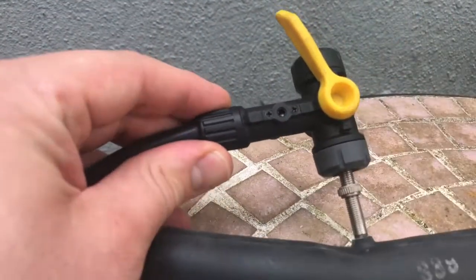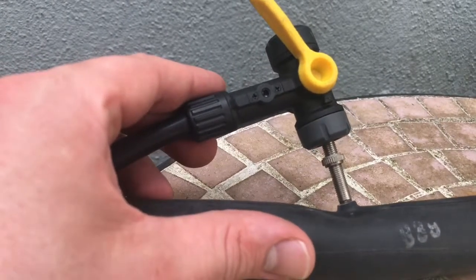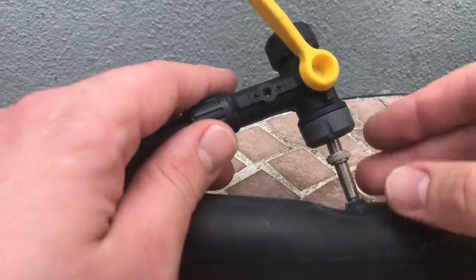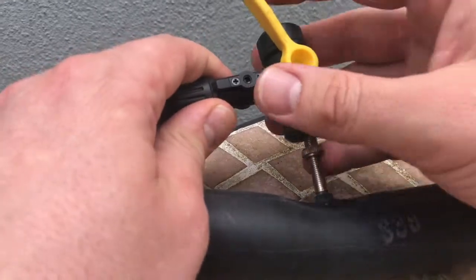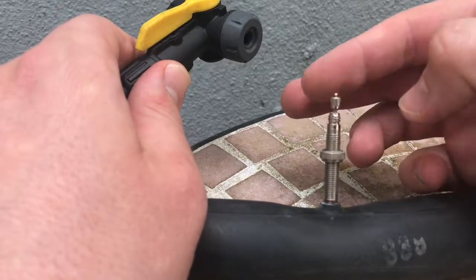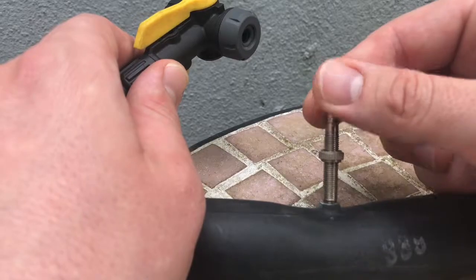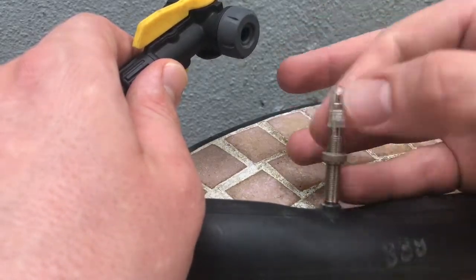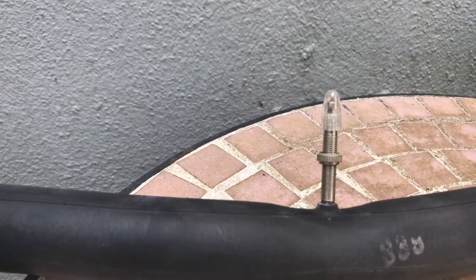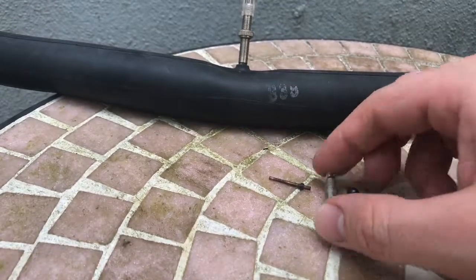Now you're able to push air inside the tube — pump it up! Good job. This is enough. The maximum pressure is 15 bar, and the drill hole is 6.5 millimeters. Now we are ready — put the dust cover on top, job's done. Easy, nice, and good high pressure!